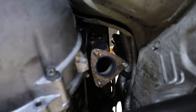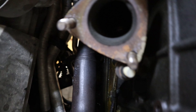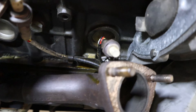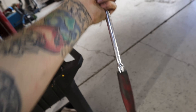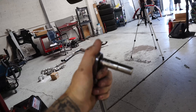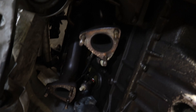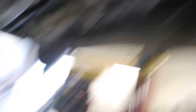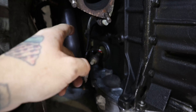We're looking pretty decent so far. I got the pipes off, got the O2 sensors out. I did mark them front and rear because that does make a difference, especially on OBD2 cars like this. There's probably eight bolts and I soaked everything in PB Blaster beforehand. I'm using an extended Harbor Freight long neck flex head ratchet with a deep 11 millimeter, and mine all just broke free on this rear header very, very easily. Thankfully — Arizona car. Hopefully the front one goes that smoothly. You can probably get away without a flex head using a short extension for the in-between runner nuts.